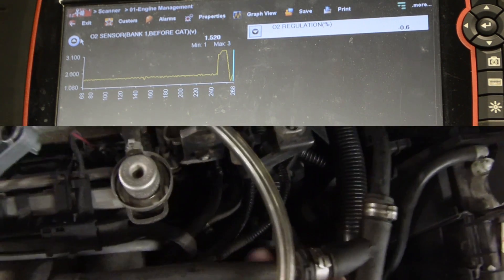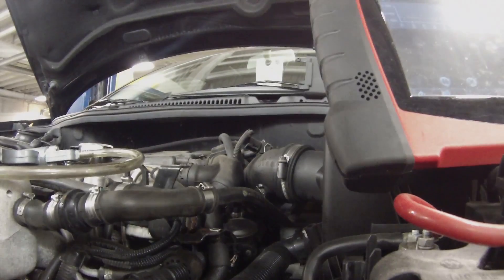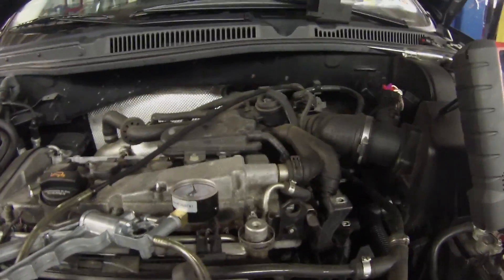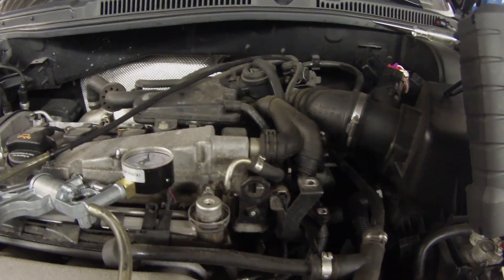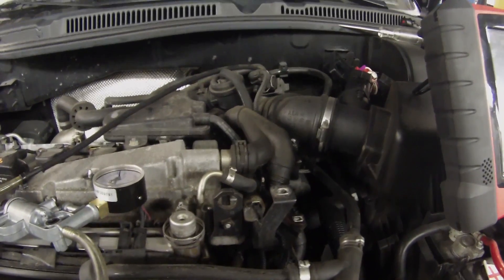The other simple test is to just disconnect this hose right here — it goes straight to the combination valve. Get this disconnected, put the camera up next to it, and when you open the valve you can hear the exhaust pulsing through that. So that tells us our combination valve works. You don't have to do it with the scan tool — just a cool test. Secondary air pump leaking through the rivets. Hope you enjoy it, thanks for watching.